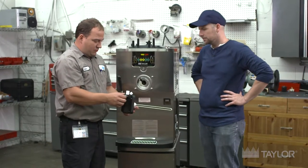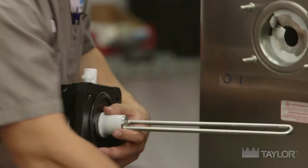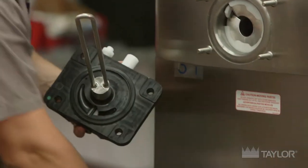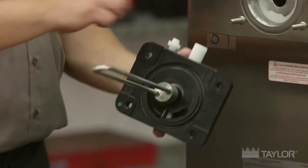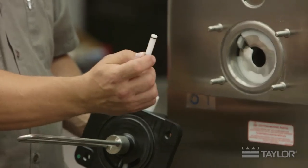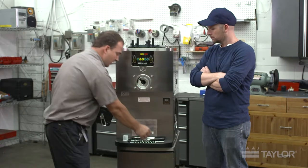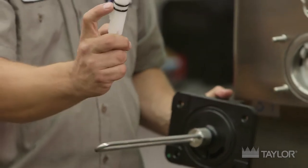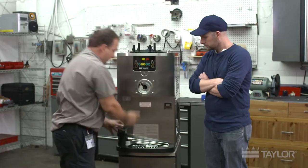This is what we call the freezer door. There's a pin here that pulls out and you can remove the draw handle. We have a guide bearing that comes off, and a seal. This is a prime plug — as we can see, there are two O-rings on here. It's very important each day that all the O-rings get taken off while the machine is being washed, because that's where bacteria likes to hide. Then we have a draw valve, which also has three O-rings on it.